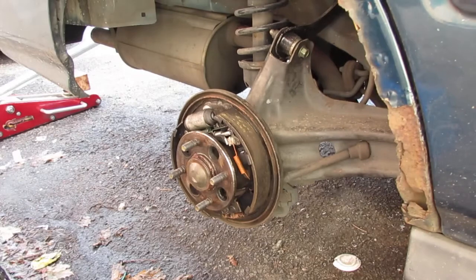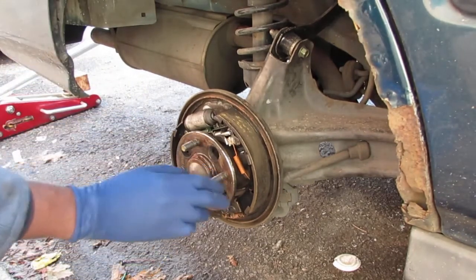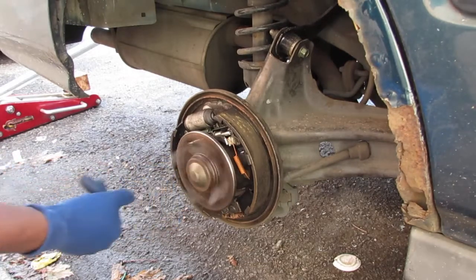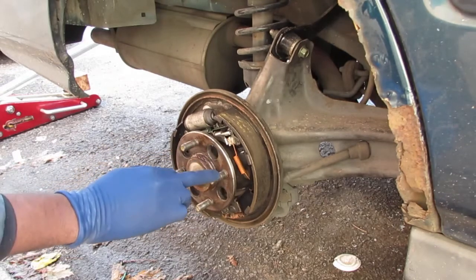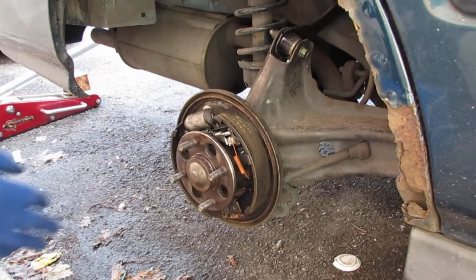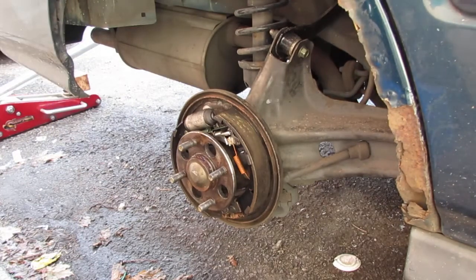Before you proceed, you want to make sure your parts match up. This is what we're trying to get rid of. Let's add another lab diagnosis — when you turn this, you hear that? So you know the bearings are failing and we need to get a new one. The driver's side is going to be a little bit worse, so let's double check before we proceed and rip this thing apart — make sure the part is the same.